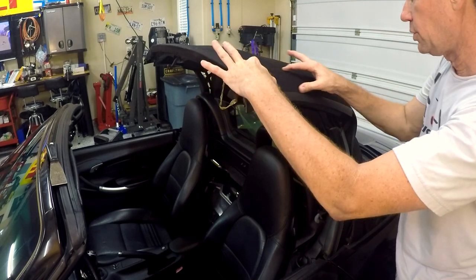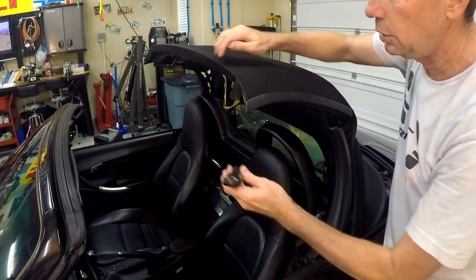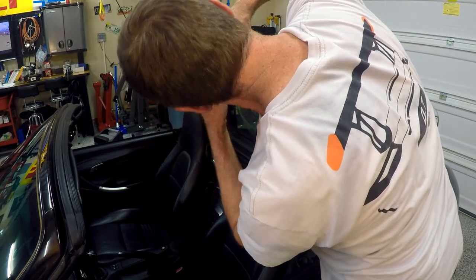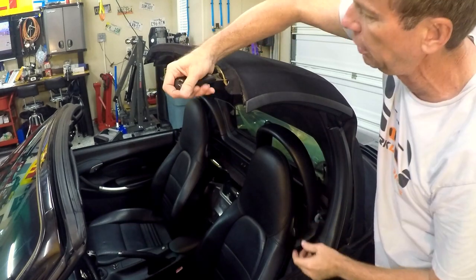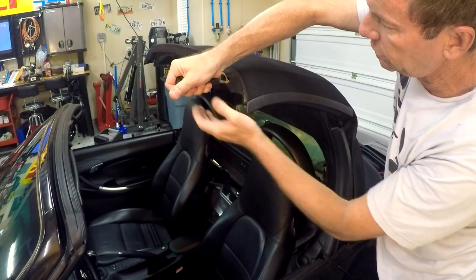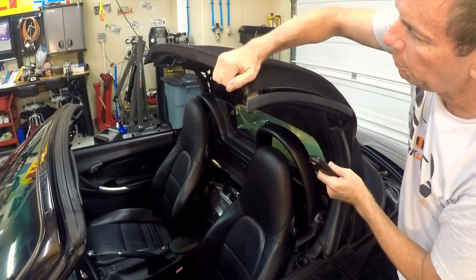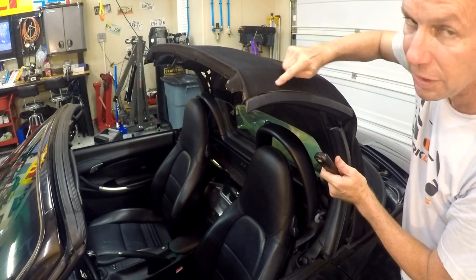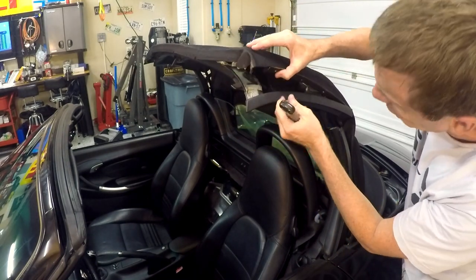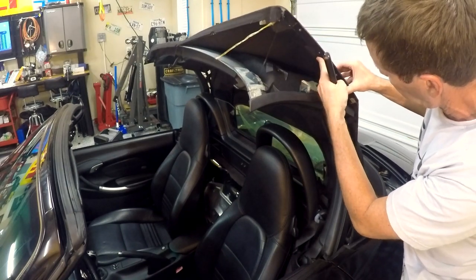Right here there's an aluminum plate and it's just glued right there — it's not tucked underneath. What I recommend is to take the putty knife and catch the bottom of the aluminum plate right here, and then just gently pull, twist, and kind of slide down until that pops up. If you try to pull this straight up, you're going to bend this aluminum plate and you'll never get it back to the line correctly. So don't take that chance — there you go, that's how it comes out.